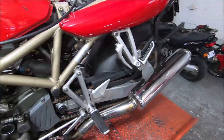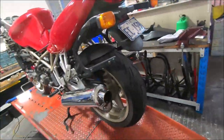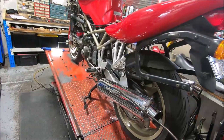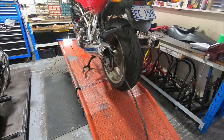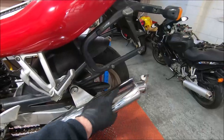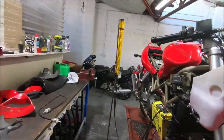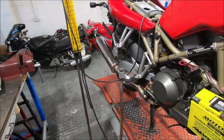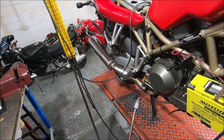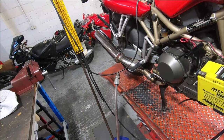This one actually has stainless cans on it, so it'll be fairly loud. I might give you an example of mixture into the actual muffler as well. I've got this long tube and as you can see it goes down towards the front of the muffler, well into the header pipe. Usually the mixture you get in the muffler will be an average of the other two. And sometimes if you can only get one plug out and fit one probe into one of the header pipes, you put this one in and try to make the muffler mixture the same. Or if you can only go to the muffler, you just make the balance the same and hope it's okay from there.